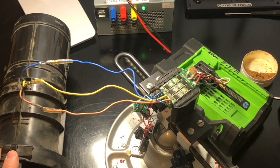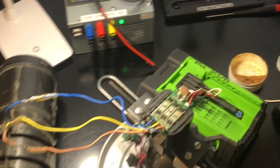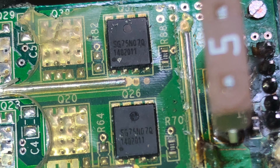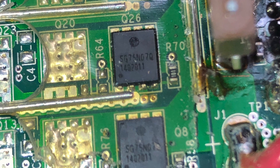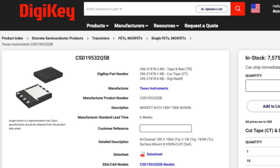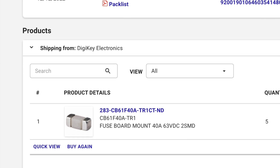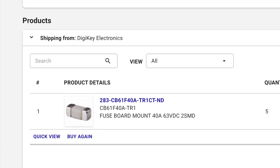It was running slowly since I was supplying just 8.4 volts from the 2S RC lithium battery, not 56 volts like the Ego battery. I was thrilled though — the RC car had functioned as a test tool to prove the problem wasn't with the Ego blower's motor. So I turned my attention back to the black box and found that one side of it was a heat sink. I was able to pry that off, revealing more of the circuit board underneath with six MOSFETs. These were a Chinese model not easy to obtain, but I used the specs to find a suitable replacement on DigiKey. Specifics are in the description.